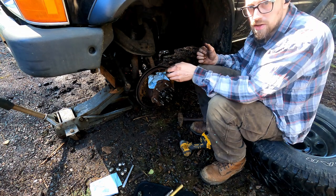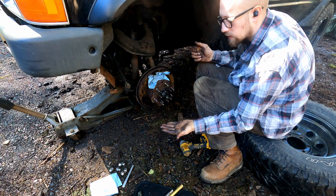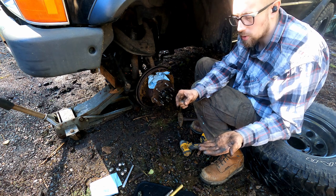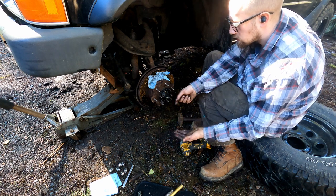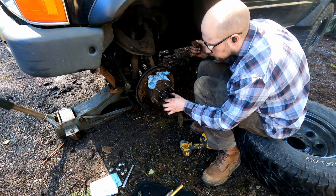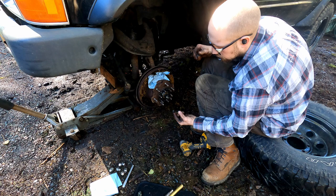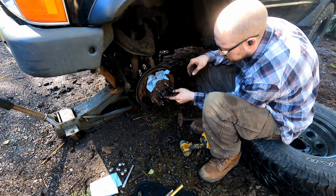These parts are available aftermarket — OEM Toyota stuff from 22R Performance, LCE Engineering, and other places — but I try to reuse them even though some are technically not considered reusable. Here's my organization method: as I take the first thing off I'll put it face down, take the snap ring off and put it straight down, then the next part straight down, stacking them offset so I can't forget the orientation. When you reassemble you pick them up and turn them in the opposite order.